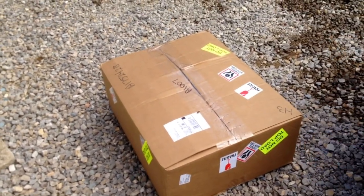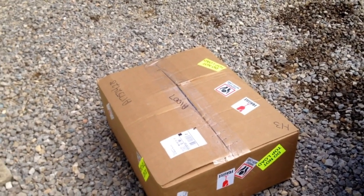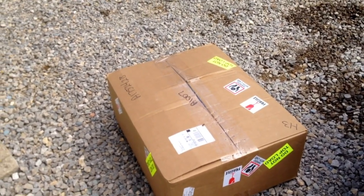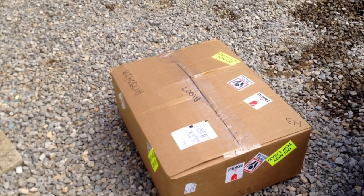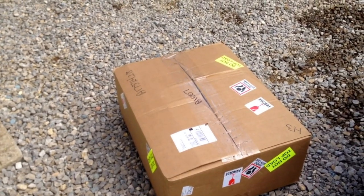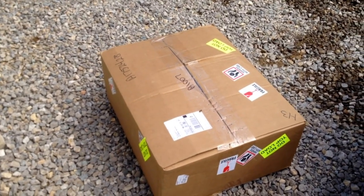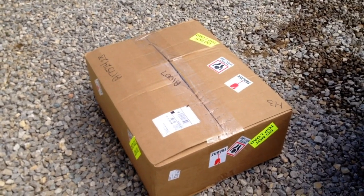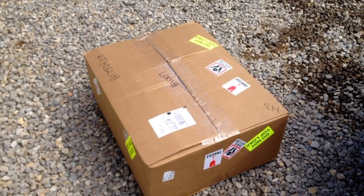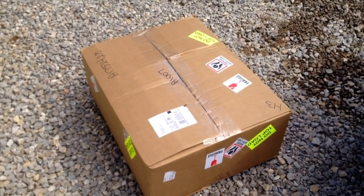I'm going to get this video uploading and go out and plug this thing in to make sure it works. I need to put his thermostat back on — a new thermostat, the second new one because the other one's leaking — and put his new fan drive back on his fan. We got the P0340 back on that M52TU on his E39. We have another exhaust cam sensor to see if that's it. That car could be out of time a little bit — hopefully it's not because I sure as hell would have done it when we had the valve cover off. Hopefully the other cam sensor takes care of it and we don't have to re-time it, but it's telltale signs that somebody did not put the secondary timing chain gears on exactly right. Thanks for watching guys, we'll see you tomorrow.